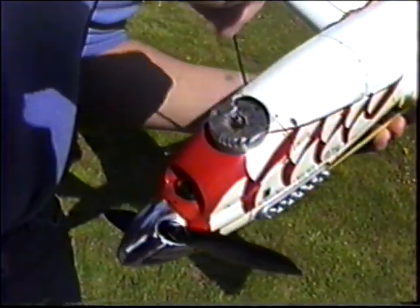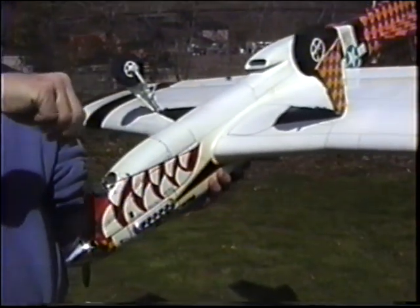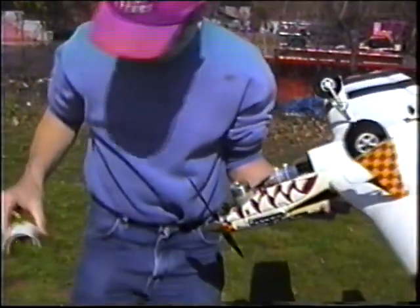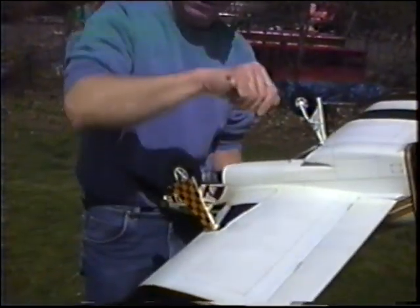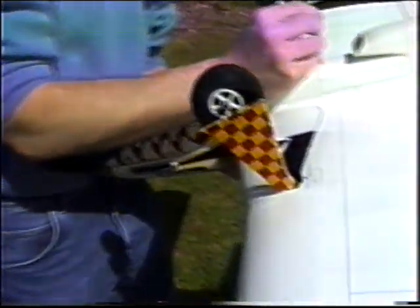What size is the Venturi in this? Stock one? Stock one. So I don't really know how that's supposed to work, I guess. Well, you'll see how much fuel it uses. That's a cheap investment. A lot of smoke. It's raw. Before you put it back, I would clean the filter, take a look anyway. See if the header screws are tight. Obviously you bench ran it because I see the goop on it. And check the glow plug.